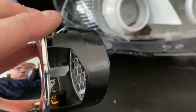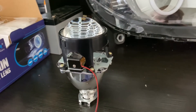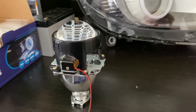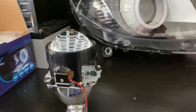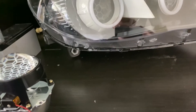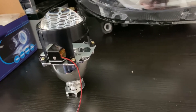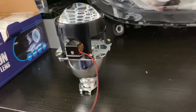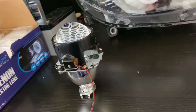That's pretty much how a projector works. Because we were putting an LED into a reflector housing where it doesn't have a cutoff point, that's where our new LEDs come in handy — the cutoff point is built into the globe itself. So we're able to run them in a reflector housing without blinding everyone coming the other way and not getting flashed every minute of the night.